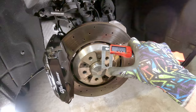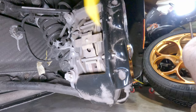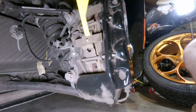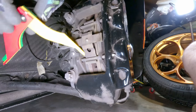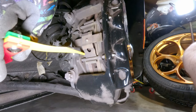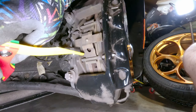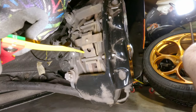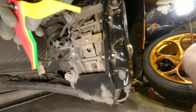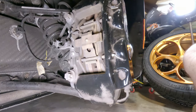What makes these different from regular calipers is this little jaw arrangement right here. Since the rotors were looking worn, I decided I should check the brake pads too. I've got these little brake pad gauges — makes checking the brake pads real easy. This is the 6 millimeter gauge and as you can see it wobbles back and forth in there, and the 8 millimeter gauge doesn't quite fit. So we're probably looking at around 7 millimeters on the brake pads, which is obviously worn but not to the point where they need to be replaced. I'm just going to leave them.